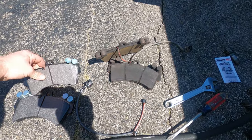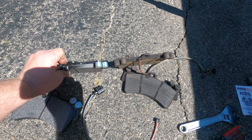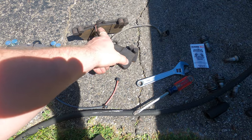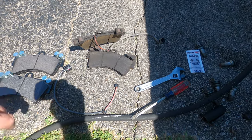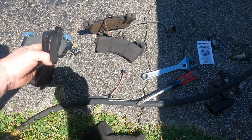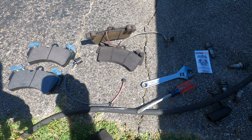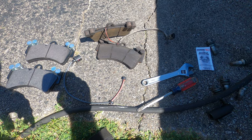Here's old versus new. Old pads, new pads — quite a bit thicker. It looks like the fronts probably aren't worn that much; they still got the grooves in them. They're not down to the sensor level, so I bet the rears set this off. It doesn't matter. These are the Hawk LTS pads, the ones for light trucks and whatnot. I decided to try those out instead of the ceramic. A lot of people said good things about them and that they're pretty low dust.